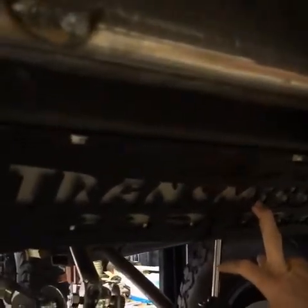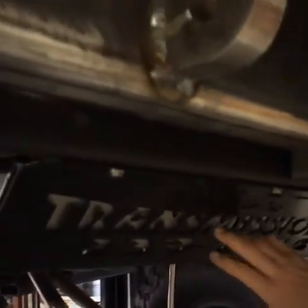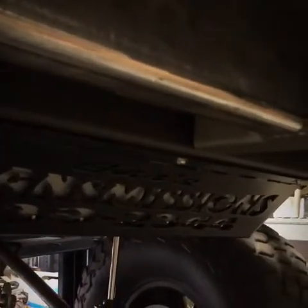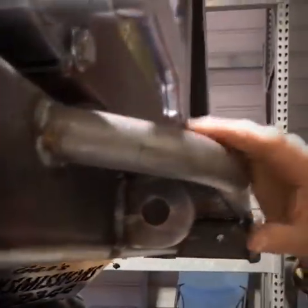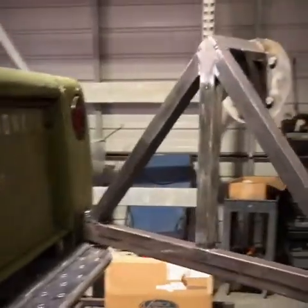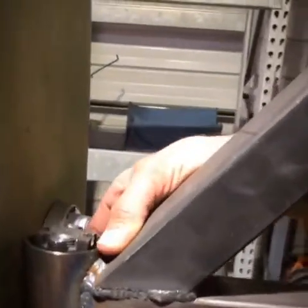The brake light will shine through the gas tank skid plate area. My business is GARS Transmission, so this will be our brake light — actually it'll be a running light so you can see it while it's running. For the rear bumper, we just did a square two-by-four tubing, welded in some big D-rings, a nice step, and found some parts online for the tire swing that unlocks, swings out, and locks itself in place.